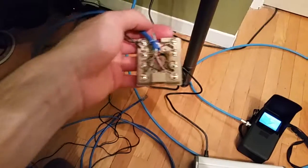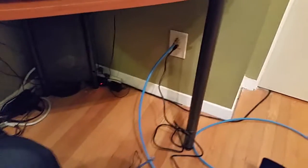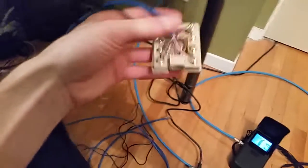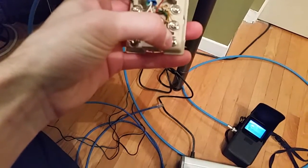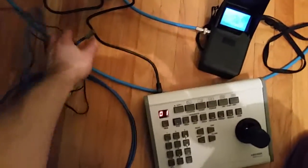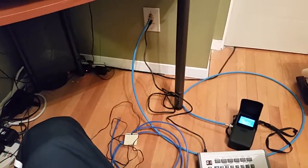I think you're supposed to use two wall blocks but it gets confusing. The way it works: using a B pattern, you run a long wire from the COM port to your jack wherever it's going to be, essentially extending the COM port to wherever you want it. Using the B pattern, the wiring is white-orange, orange, brown, white-brown. That goes into the keyboard via a patch cable, and the other end goes into the COM port of the matrix switch.